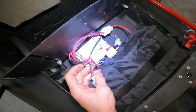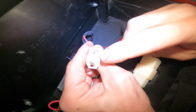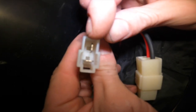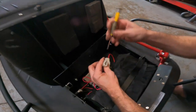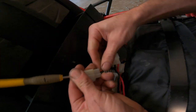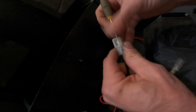And so basically, to get this motor wiring out intact, what you need to do is take this wire, and there's two pins that you actually need to press down in here. We're gonna try to focus in on this. And you see that little open rectangle above these two silver pins? That's what that small flathead screwdriver is for, that I was showing you in the beginning of the video. This tool right here. So basically you need to shove this into that opening. Hopefully you can see it. You push it in there, and the pin should come out of the plastic connector. You can see I'm shoving it into this rectangular opening, and then the pin should unlock and slide right out of the connector.